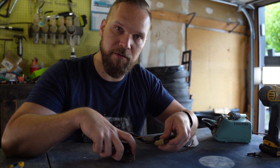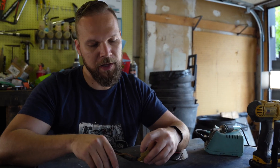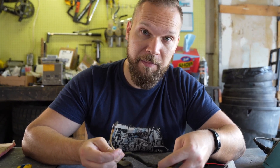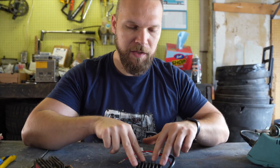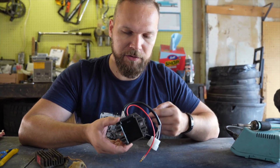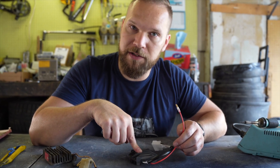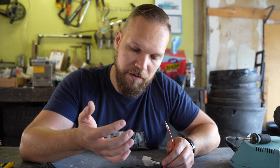As you start to use things the voltage will drop, and the voltage drop on the signal wire will tell this unit that you need more voltage and it will produce more voltage. So if you need 14 volts and this dips down to 12, instead of being 14 it will jump up to 16 — that will blow up a lithium ion battery real quick. The magic in these units — and it looks like a solid block of aluminum — there's no signal wire. It knows exactly how much voltage it needs to put out and puts that much voltage out. No signal wire with a lithium ion Reg Rec is fantastic news for safety and efficiency.